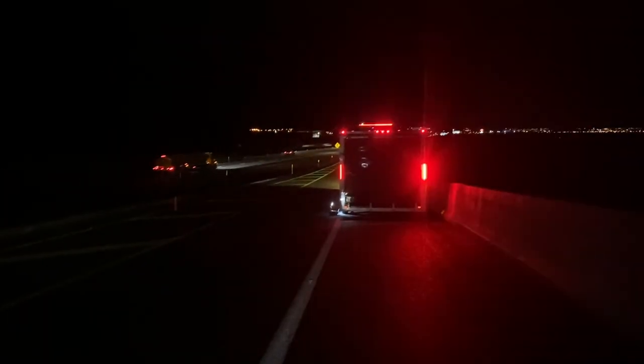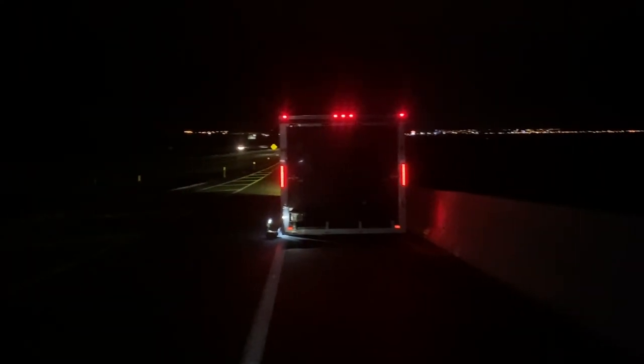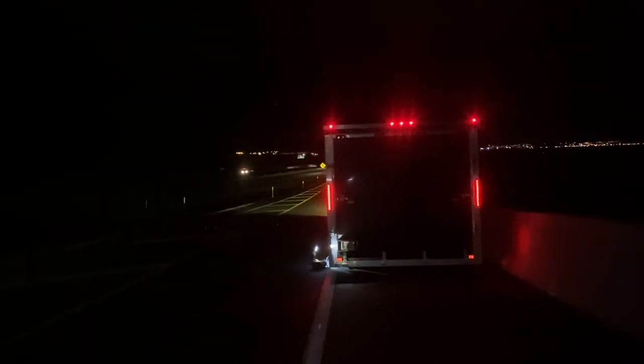And that stuff looks like it might start to hold. I kind of found where the hole was, where the screw came out, and it looks kind of gummy. I think it's so difficult because it's sort of on the side of the tire. If it was right in the middle, it'd probably be a little easier. But since it's on the side, I think that stuff's having a harder time reaching it, if that makes sense. It wasn't that long of a screw, as you guys saw, so it can only get so high up on the side. But hopefully I'm going to fill it all the way up to 65, and hopefully that works this time. If it keeps going down, I'm going to have to stop somewhere and get the right kind of patch.